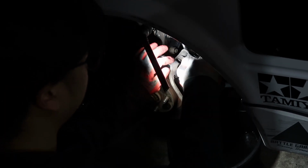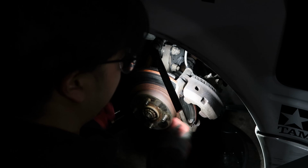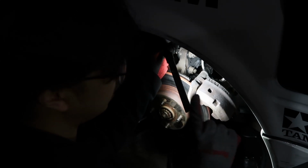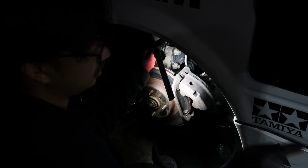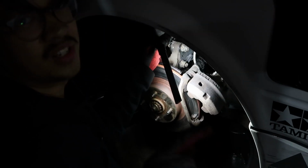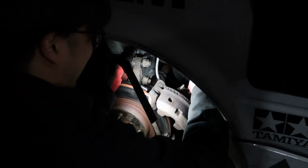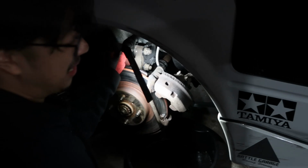But even without doing this, and just unlatching the handbrake cable bracket, it was freely moving. So I think our issue was our handbrake was dragging. The actual solution would be to go underneath and adjust the handbrake cables, but forget that right now. I'm just going to unbolt the bracket for this and run no handbrake for now.